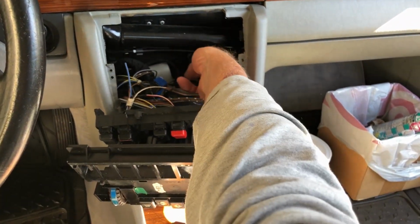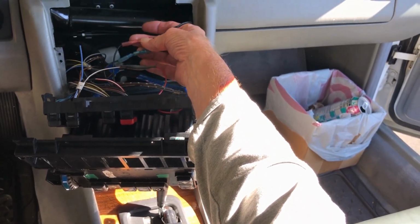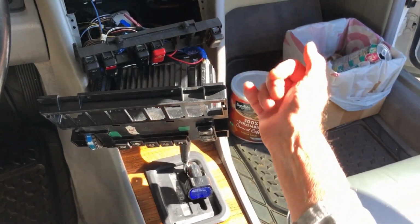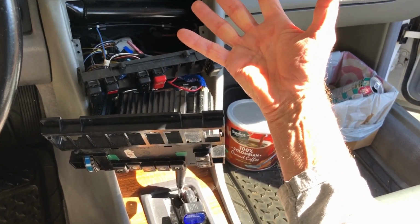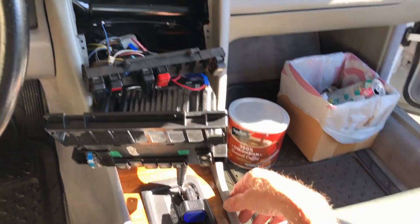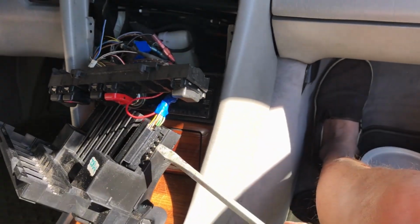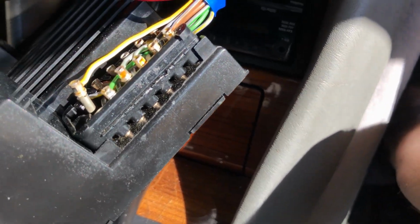We did notice that there's some weird random wire right here. Now, what is that? I think it goes to a speaker over there. So maybe he pulled all this out, unplugged this. One of these came apart and all the things came out, and he said, oh well, I'll just put it back in. Maybe all the wire pins popped out of the thing, which can happen, and he just put it back together wrong. Okay, you can just stick a screwdriver right here and this part will pop off like that. And you can see these pins are loose already.